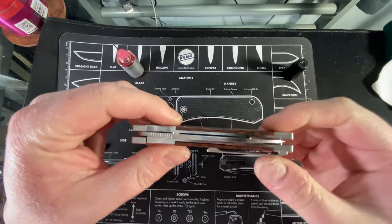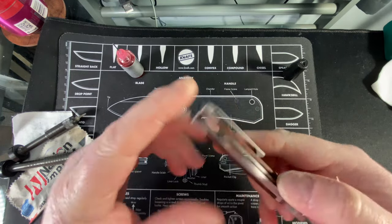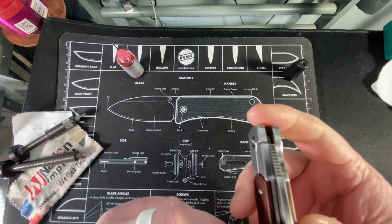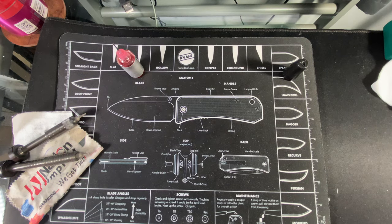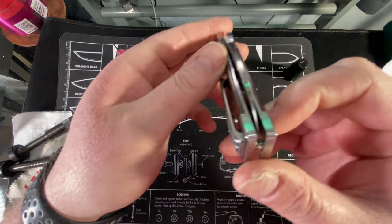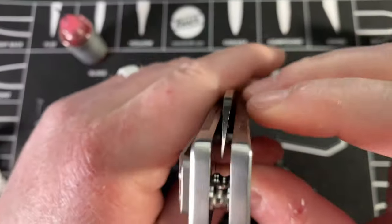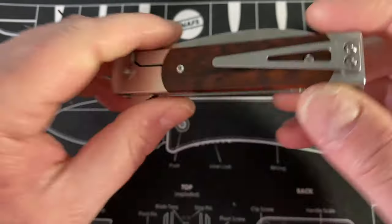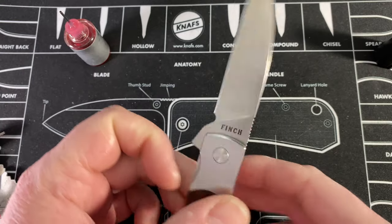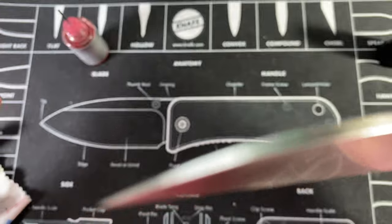I'm surprised by those bearings. Let's see the centering - did I nail it? Yeah, look at that guys - we nailed the centering! I think the bearings were installed backwards at the factory by QSP. I just flipped them around and now the centering is dead nuts with no play.